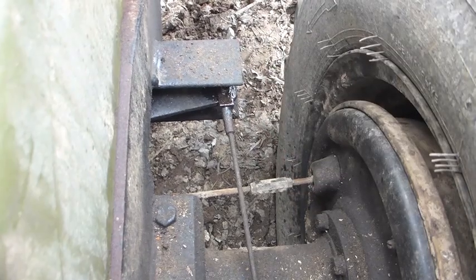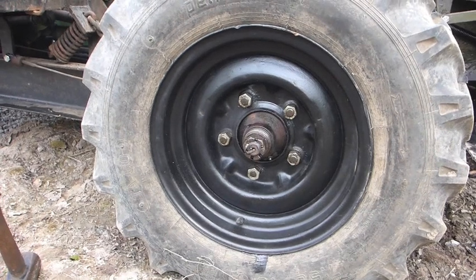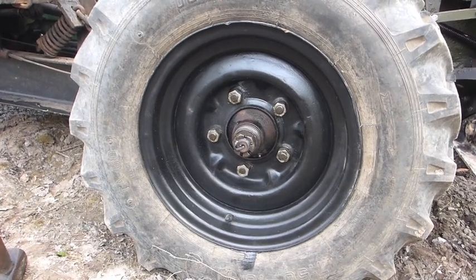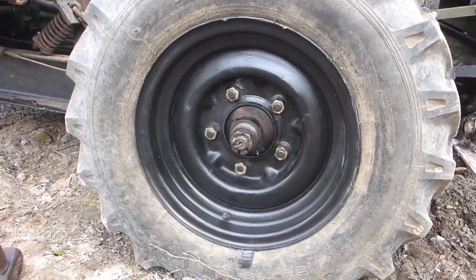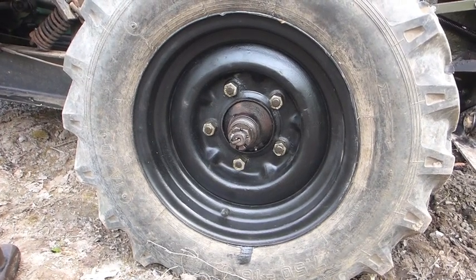Same boots as used on the clutch, which is a brake drum — more on that later. I haven't said much about the brakes other than the control rods. Everything that goes on inside the brakes, as far as I'm aware, the parts are no longer obtainable. I was lucky with mine — I didn't need any parts apart from getting the shoes re-lined, which I had done with a local brake re-lining firm.